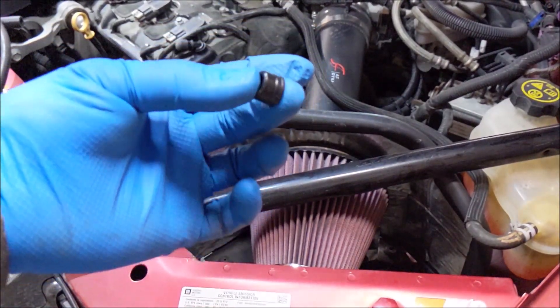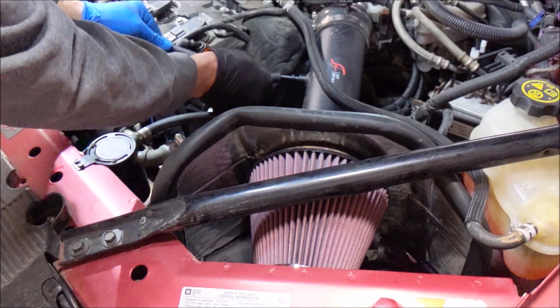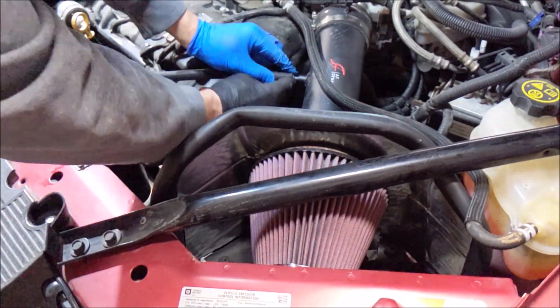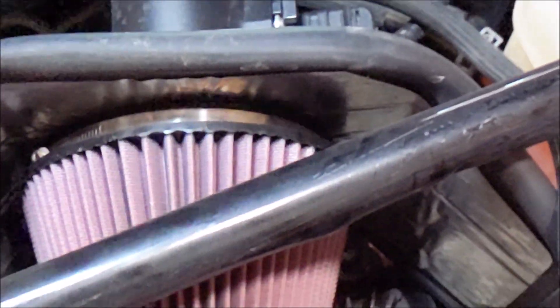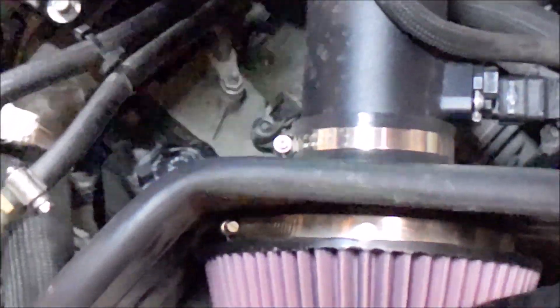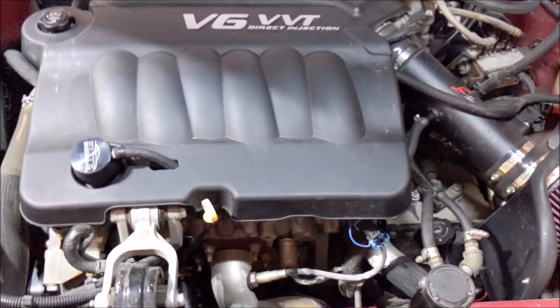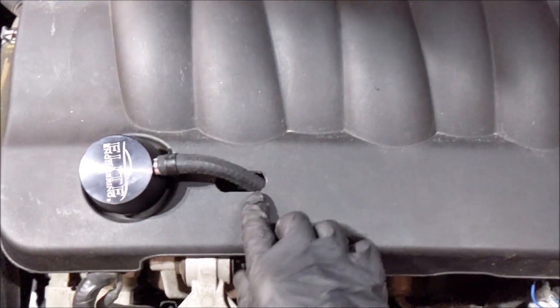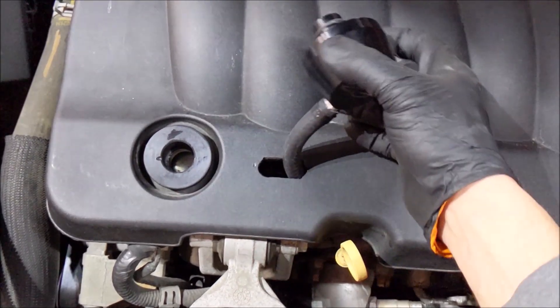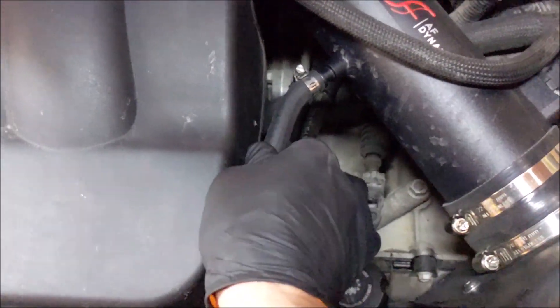Big break in the story — this little piece came off the original connector, and I found I can just jam this hose right on here. I just need to get it up over this little lip. I'll get that hose up over that lip, put a clamp on it, and then I don't have to use the extra connector I was trying to use for the transition. The hose exits right here with a little slack, and I put a hose clamp on there good and snug.